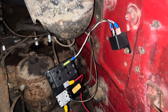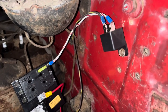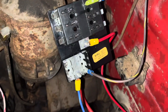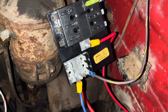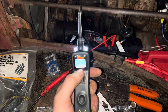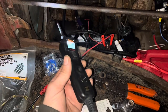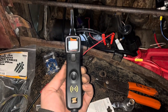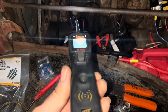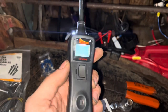I've taken the liberty of mounting a relay and running a couple basic wires. I do want to note that generally you'll need somewhere to run grounds that works well — usually this will be the metal of the body, but in this case this relay panel has a handy-dandy bus bar built onto it. I've also taken the liberty of grabbing my power probe. This is a fantastic tool — I can put out 12-volt power or ground, which is great for testing devices and circuits. I somehow monkeyed with wiring for well over a decade before buying one of these. They do not sponsor me, but they probably should, because I've bought four of them. This one is already kind of broken, but anyway.